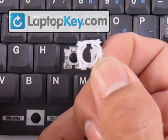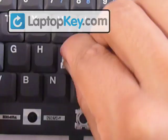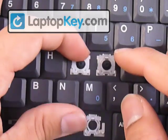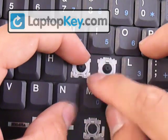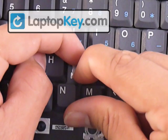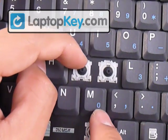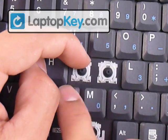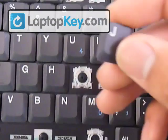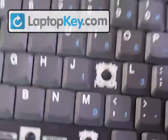Put the top bar of the small piece underneath the large hook. Keep it in place with one hand, and with the other hand stretch or slide the hinges down enough for the lower hook to grab onto the pins down there. Slide and push downwards. Make sure not to push down against the keyboard until you're sure the hinges can wrap around those metal hooks. Now that that's in place, put your keycap right in the center and push down evenly on all four sides. That's it for the regular size key.